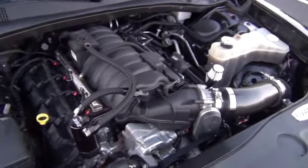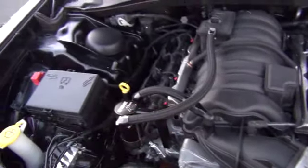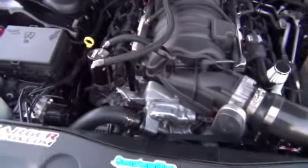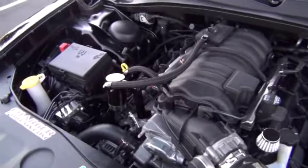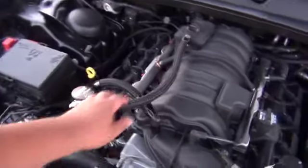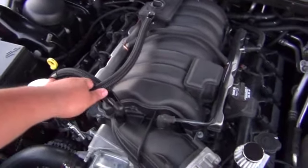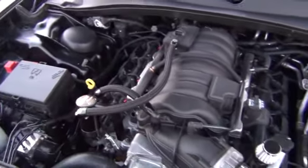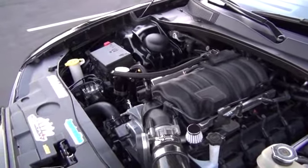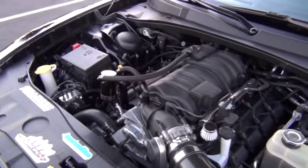For those of you that knew about my stainless steel hose problem — basically it was a vacuum leak. I got some stuff from Speedlogix and apparently the whole spool of stainless steel was bad. What happens is it collapses in on itself and causes a vacuum leak, and your car will go into a high idle somewhere around 3,000 to 4,000 RPMs. So you can peel out in the middle of a dead stop and you have to hold the brake and shut off the engine.